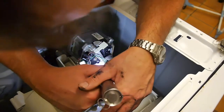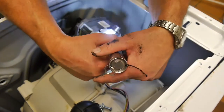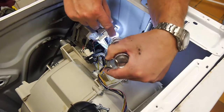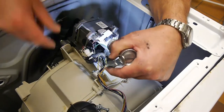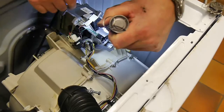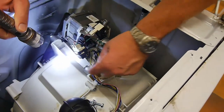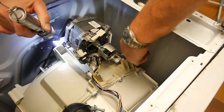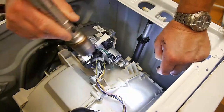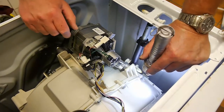Now, I reckon that this will benefit from the electromotor being taken out and the armature being cleaned up. I don't have any spare carbon brushes to put in there, otherwise I'd put them in. But what I'm going to do is take this motor off somehow. I have no idea. These are the securing nuts there, so I guess an Allen key or something in there. Undo there, one, two, three, three points. No, four mounting points, there's one other one here. So four mounting points, take the motor out, get it on the bench, and take this off somehow. So I'm going to do that right now. Okay, see you later.